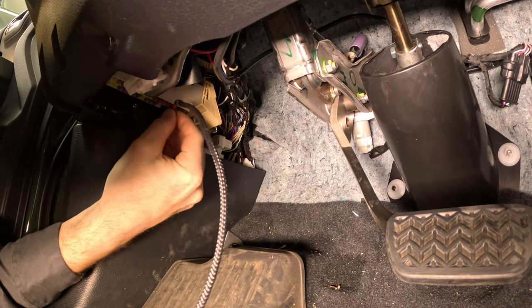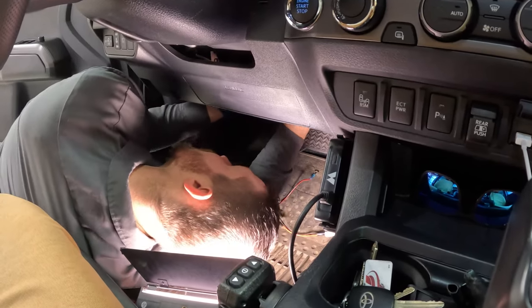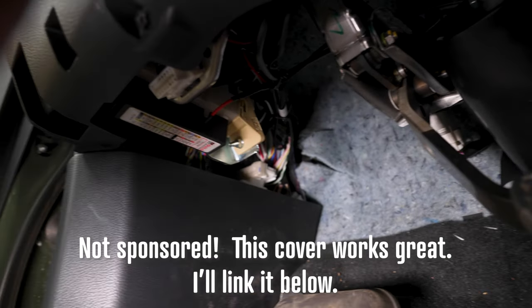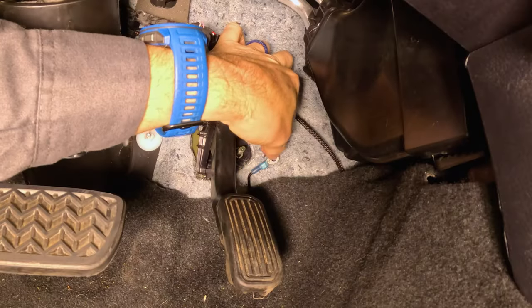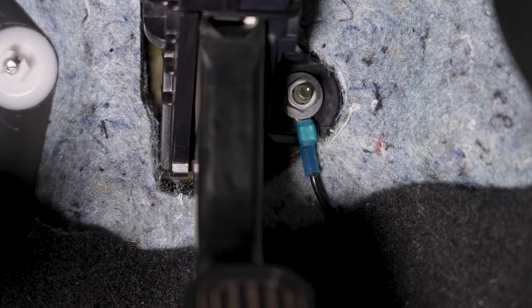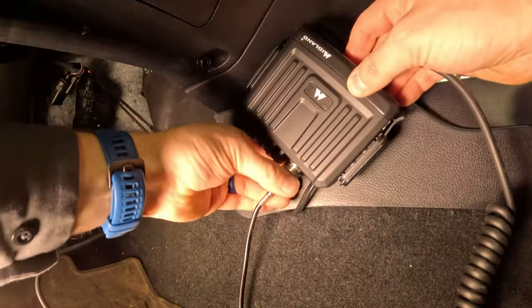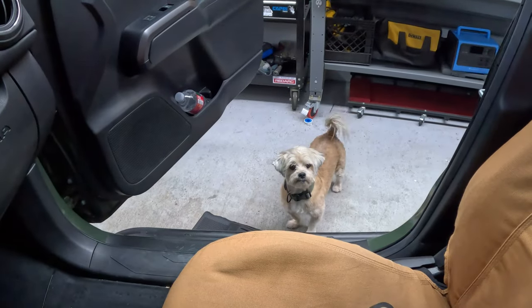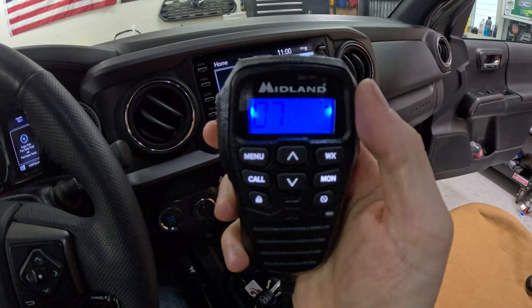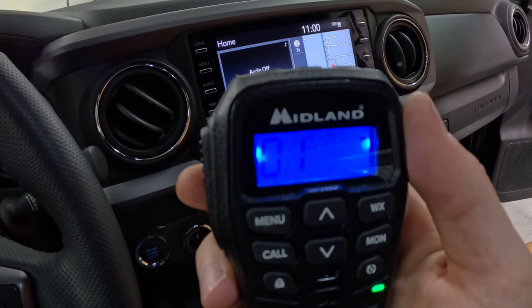With all that done, finishing up the radio install is a cakewalk. I routed the positive wire with the add-a-circuit to the fuse block and secured it away from any hazards with zip ties. I then installed my extended fuse cover from Guild Outfitters with the fuse diagram sticker that matched my truck. I attached my ground wire to the firewall near the throttle and tucked away all the wiring underneath the carpet. Lastly, I routed the antenna cable to the radio — super easy — and stored the excess behind the center console. Simple as that. Hey Toby, you want to test the radio? Washington Cascades: from late tonight through late Tuesday night, travel could be very difficult. Monitor the latest forecast for updates. Winter weather ahead!